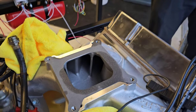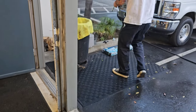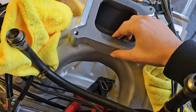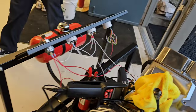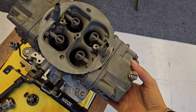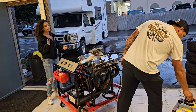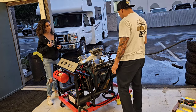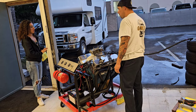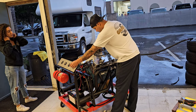You guys ready for this? To the streets. This carburetor's for the streets. Let's get this other one on. Oh, I need the vacuum port on the metering block. The little vacuum plug. Yeah. Okay, I have the idle open just a little bit. All right, we got carburetor number two on. So let's try our luck again. Okay, I'm gonna watch for leaks and oil pressure. Ready? Yep.